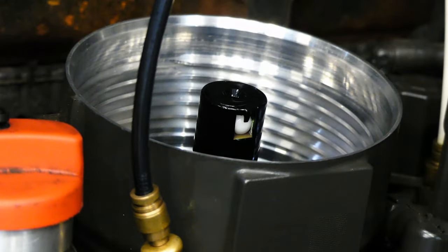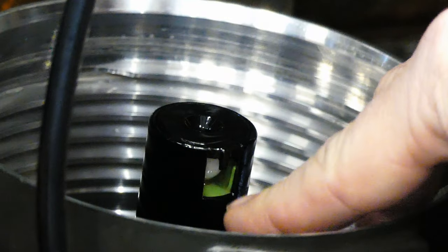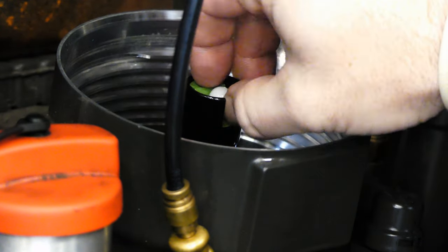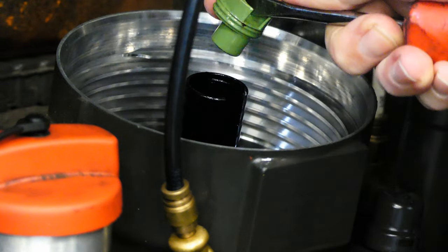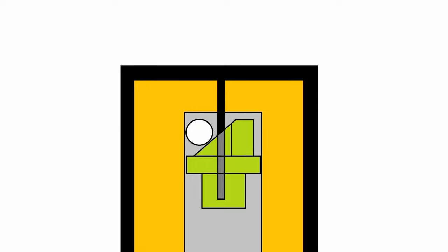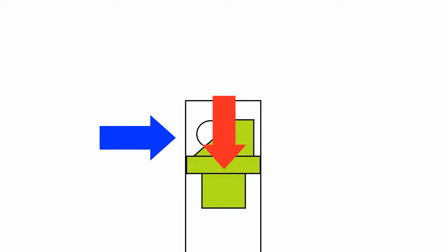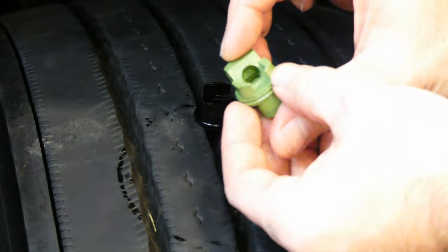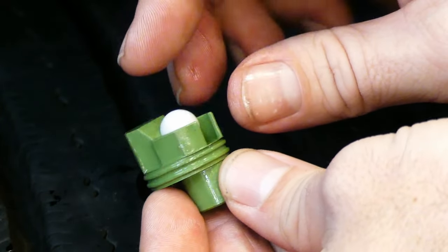Inside the filter module you'll notice a little white ball sitting in this standpipe. While the filter is out, check to make sure that the ball is still present and not stuck — it should move around easily when you tap it. If you need to access the check ball just use a flathead to pry up on this black cover, then pull the white ball out. Using another flathead you can pry up on the green piece. The purpose of this check ball is to prevent fuel flow if there is no filter installed. The fuel filter has a peg hanging downward that prevents the check ball from seating against that green valve. With no filter there is nothing preventing the ball from moving, and fuel flow causes the ball to move into the valve opening and seal it off. Check to make sure that the ball is still in good shape and not broken, missing, or lodged into the green valve. If the ball is missing there's a chance that it broke and made its way down into the fuel gallery, which could damage fuel system components.